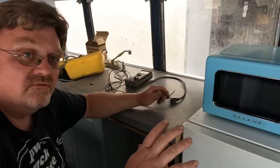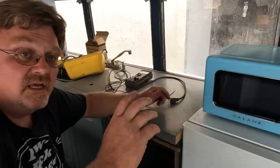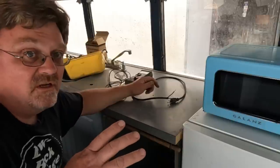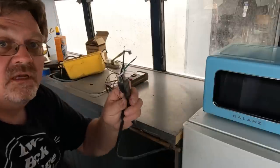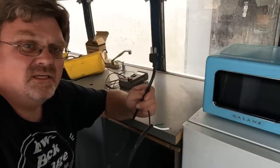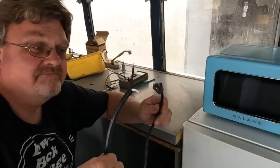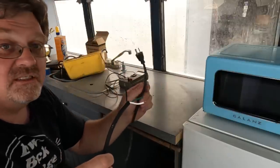Before I hook up too much to that inverter, I want to check and make sure it's working properly. If it's putting out too low voltage, it can make things like the compressor in that fridge run too slow, work too hard, overheat — something bad could happen. I just want to make sure it's putting out the right voltage. I already have a voltmeter and a test cable. Sometimes I wonder if I should be doing those 'do not try this at home' disclaimers, because when I plug this in and these wires are all bare and live lying around the counter, do I really need to tell people to not lick them? I think you guys are smarter than that — if you want to lick them, you can. I'm not going to though. So we're going to plug this in and check the voltage.